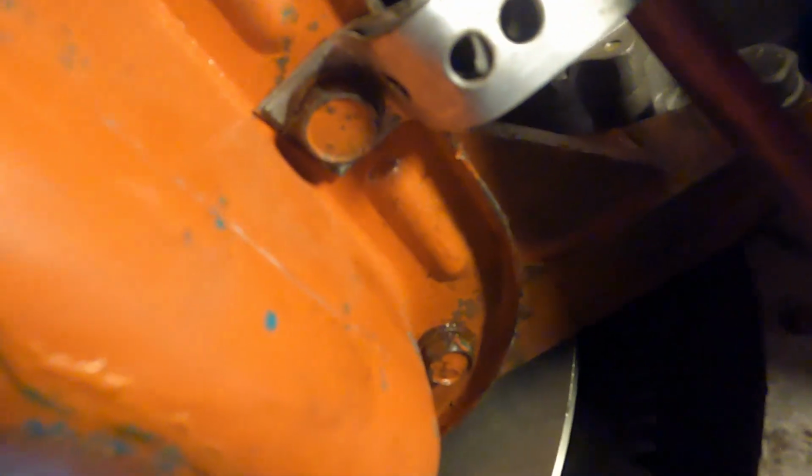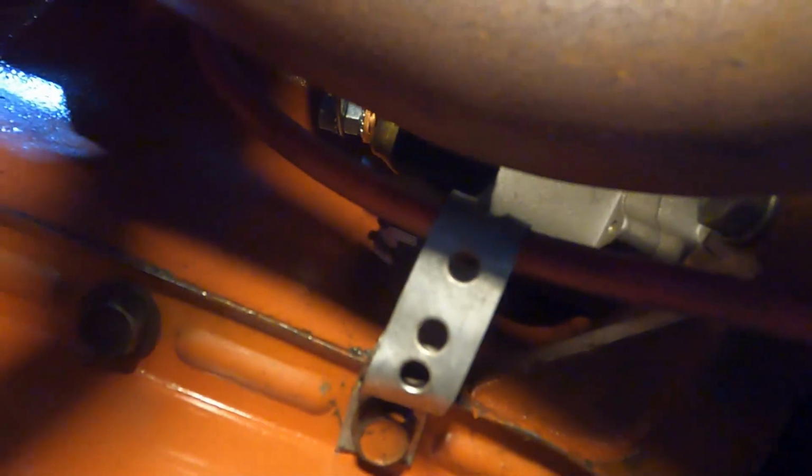Need both hands, I think, for this. I'm gonna get up there and loosen the starter connections. And I've got this bracket also on the oil pan rail that keeps the shifter cable out of the header. So I'll get those things done next. This is kind of where I prefer to turn the camera off, because it's mostly just me cursing for 15 minutes, trying to get out that bolt in the engine that also holds the transmission dipstick. Yeah, that one's fun. Stay on there.